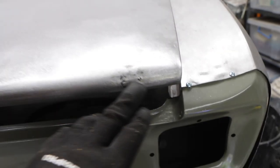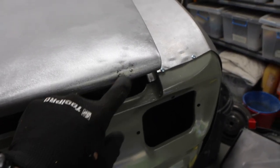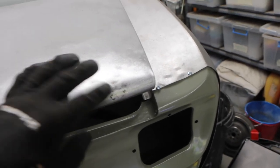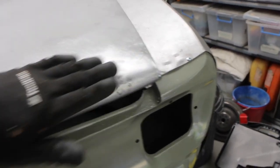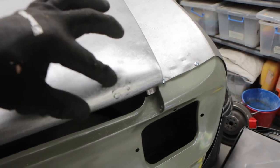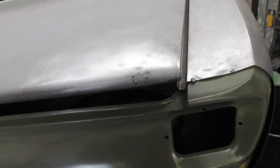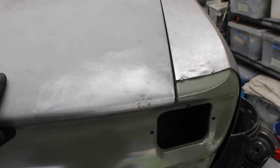All right, there was lots of backwards and forwards with that. The dent is out. I used the MIG and then I went in through and used the TIG. It looks like every time I was welding it, it was sort of shrinking it back. So I've just decided that's enough. It's gonna need a tiny little skim over it, but it's pretty flat. There's a very tiny low just up here, you can see from the sanding. It's gonna need the thinnest little skim to tidy it up, but that will do the job.